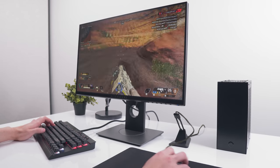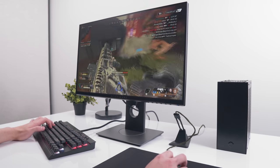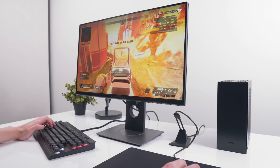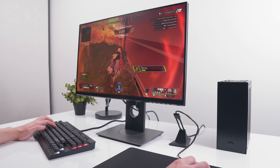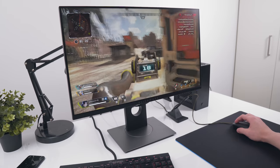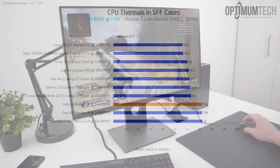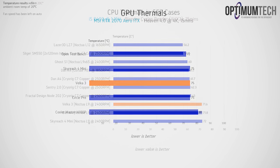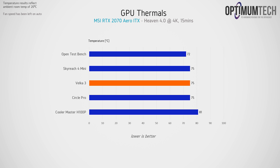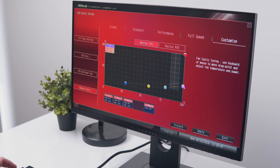The result is definitely a rewarding one. I'm really happy with how the finished build looks, even with the side panels off. It is really hard to believe that inside there is a 6-core CPU, an RTX 2070, two 80mm fans, and a 400W power supply — all fully internal, no need to carry around an external power brick. Gaming with this thing was really surreal — you're pushing so many frames and having a near flawless gaming experience from what is basically the size of a brick. CPU and GPU thermals were basically as expected, right in check with the Skyreach 4 Mini using the same components, so thermals aren't an issue here. If you do go with the top two fans, I'd recommend setting a pretty conservative custom fan curve as these aren't very quiet, and they likely don't provide a significant improvement to thermals anyway.